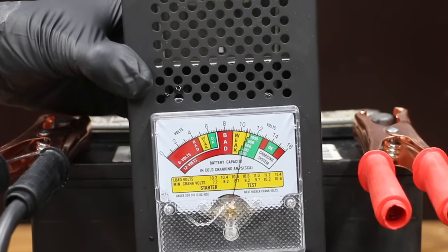Just to recap before zapping the battery with the welder: when the battery was fully charged, it started out at 62 amps and failed the load test. And the moment of truth — the battery is almost fully charged at 12.55 volts, and the battery tester now says that the battery is good and it's now at 961 amps. Very impressive! The state of health is at 81%, which is up from only 6%, and the internal resistance is at only 4.26 — a very good number. Before zapping the battery with the welder, the tester went straight to red indicating that the battery was bad. After six cycles with the welder, the battery started off around 1,000 amps and dropped to around 900, so the battery is definitely performing extremely well.